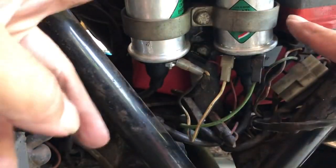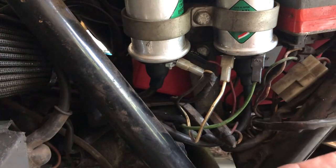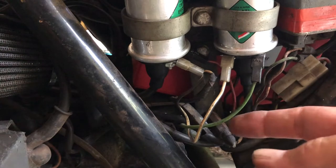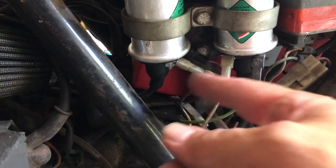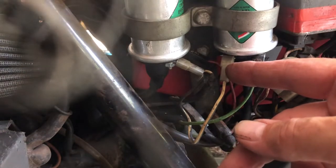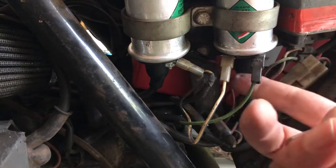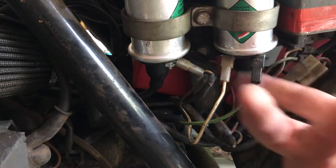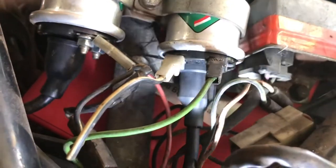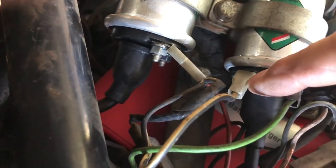The instruction says get the two coils. There is one wide wire going to one coil - that's this one, looks pretty wide. Then it says there's a short black-blue wire that connects the two points. I don't see black-blue but I see black-white that connects the two. Then it says connect the separate red wire included to the spare spade terminal on the positive terminal of that coil. I don't have a spare connector here, so I definitely don't have any spare connectors down here.